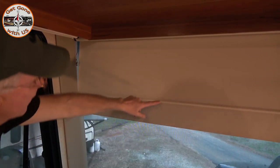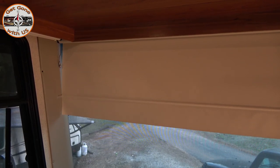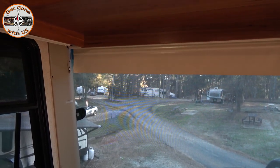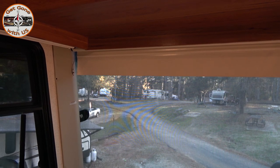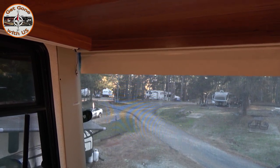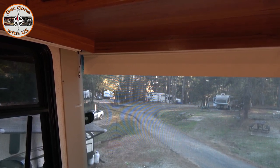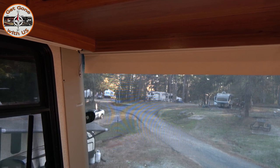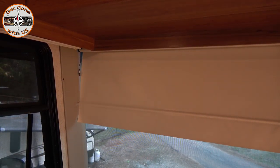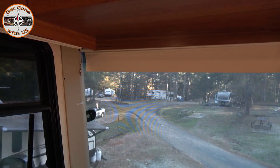Now when I bring it up, I'm going to take this line and get it right underneath the roller. I'm going to push it up — you're going to hear beeping, and the beeping indicates that it is locked in. Now I'm going to come up and stop just before. Once you stop pushing for continuous motion, you will not be able to do it again in learning mode, but if you just bump it, it will go in sixteenth-of-an-inch increments. That looks good. Then I'm going to push the down button, because that's going to lock in the upper limit, and you'll hear the beeping. It should stop where we set it, and when I put it up, it should go to where I just set it. That's going to be much better.